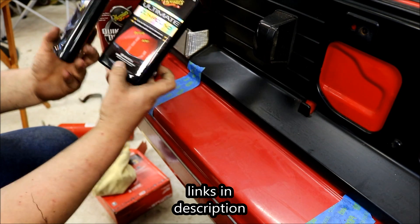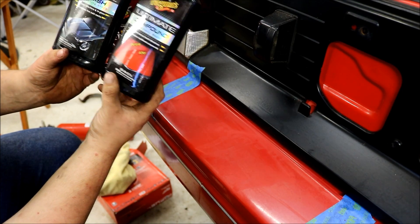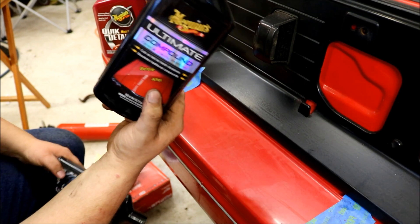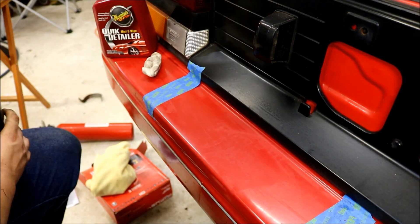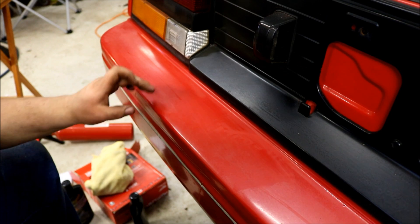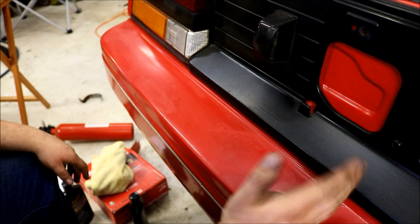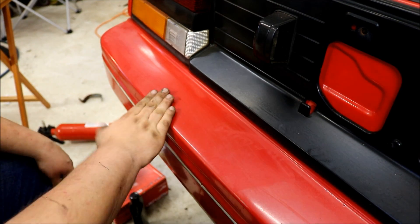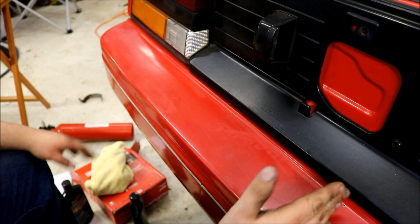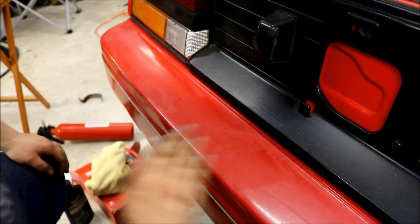These are the two basic hand products. First we're going to hit it with the Ultimate Compound and then a pre-waxing glaze. You can really see the before and after, and truly as long as you have paint it does do this. What you can't see is this side is just faded and this side is clean — I've just cleaned it. It's super faded, should be a nice bright red, but it's not. So I'm going to do a buff and polish. It's just faded and needs to be renewed, so I'm going to put a piece of tape down.